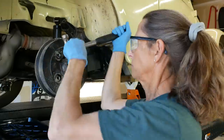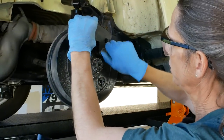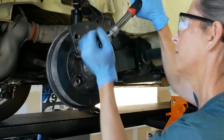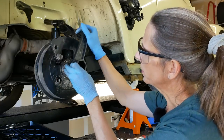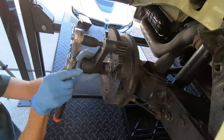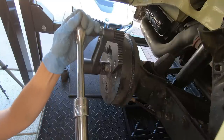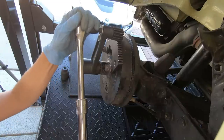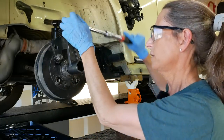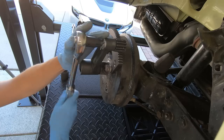With the wheel off, our next step is to pull out this big cotter pin. We take our wheel bolts and attach this gear ring to the hub. The way it works: we put this over the top, make sure the gears are meshing up at the top, then it's just a matter of rolling it across the gear rail and loosening the castle nut. And there we go — loosening our castle nut. It's actually pretty loose at this point.